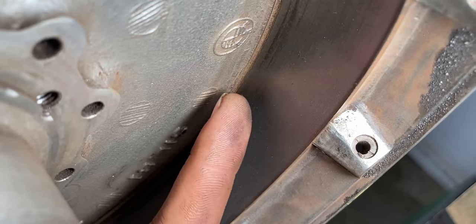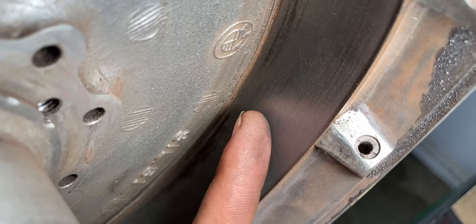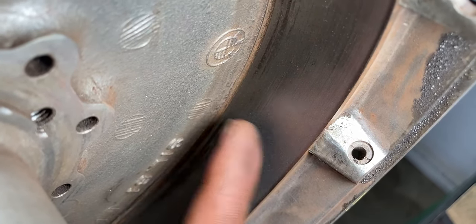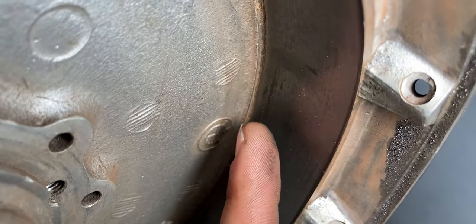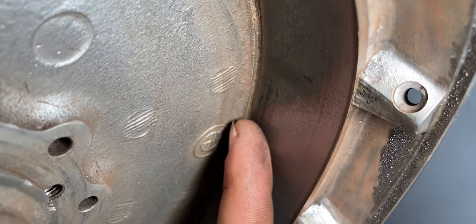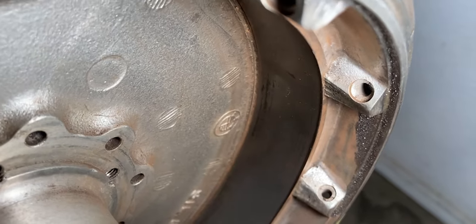This is how the finish looks — it's very reflective and I'm really happy with the surface finish. That means the spindle speed is just fine and the feed rate is also really good. But when we look up above there are still some low spots and some imperfections. They're not very deep but I want to get those out of the brake material, so I'm going to give it one last cut and hopefully those imperfections will be gone.